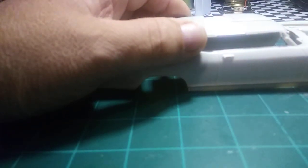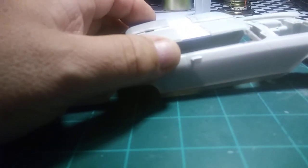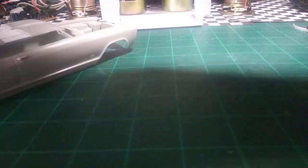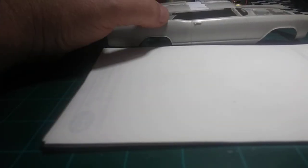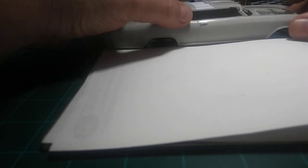Now on this Riviera - this one turned out to be a five-inch roof chop, four and a half to five inches. I wanted it really dramatic, so I took out quite a bit. As you can see on the roof, look how much I had to take out of the center and over here. This roof is cut in an X - that's how much of a spread happened.